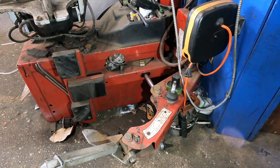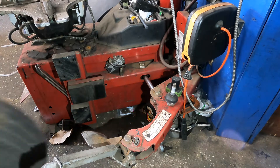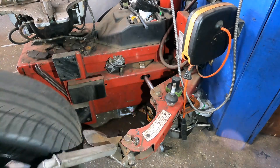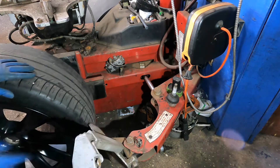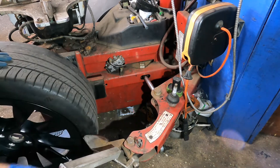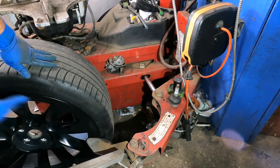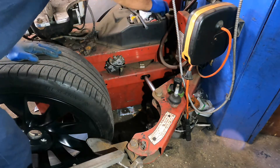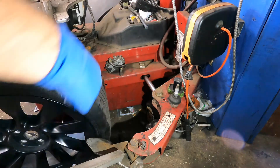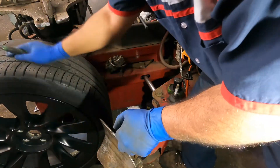As you release the air pressure you might hear some clicking from the car — that's fine. Your valve stem is your TPMS sensor, so you don't want to damage it. I'm breaking the bead from the opposite side of the sensor. The sensor is all the way up here, so I'll break the bead from down here. My machine is a bit crappy, bear with me — the key is not to damage the rim.